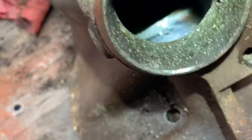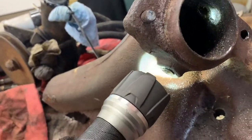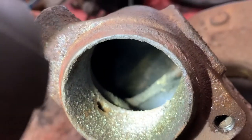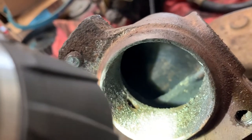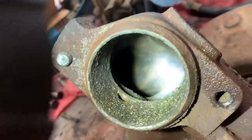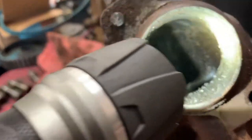On this side, there's a sharp edge right around the circumference of the opening — see it just past the hole to the heat riser valve? Exhaust is pushing out, so whatever it comes up against restricts the flow. Anything you can do to smooth out edges or 90-degree surfaces is going to increase the flow. We're not building a race car here — I'm not going to port this thing and gain 20 horsepower. But every little bit helps, especially when you're dealing with 215 horsepower, which is what these Sprint engines had.